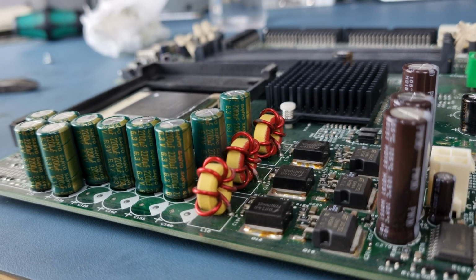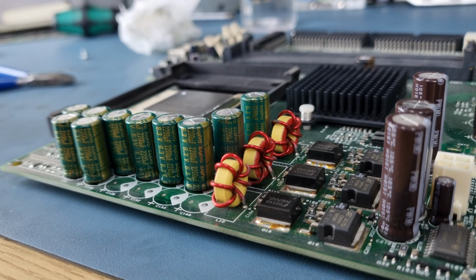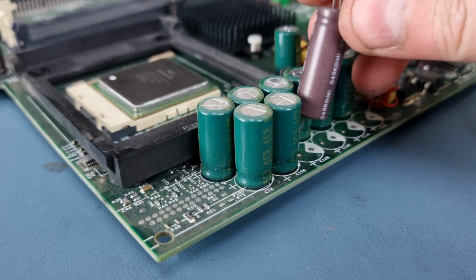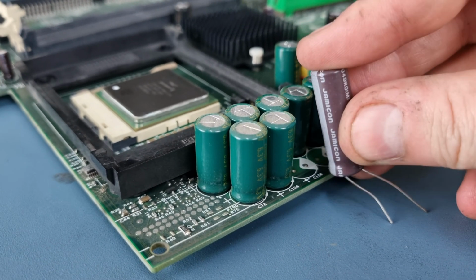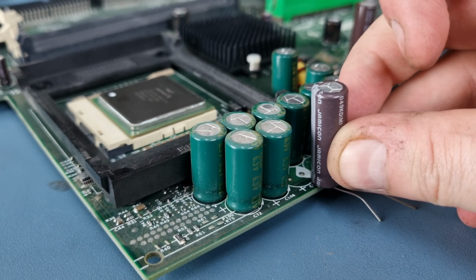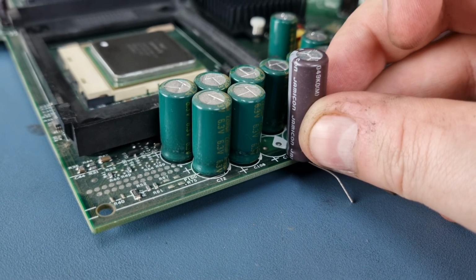That last point is very important. Solder one of these bad boys in the wrong way round and you'll be asking for trouble. It doesn't matter too much if you use the exact same make and model of capacitor, so long as the rated capacitance and voltage are the same as the original. Depending on the manufacturer, you might even find the replacements look quite different, but as long as the hole spacings are pretty similar, it doesn't really matter.